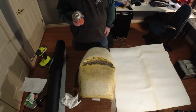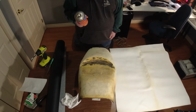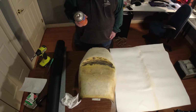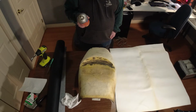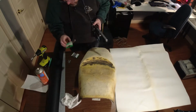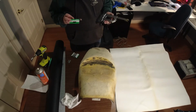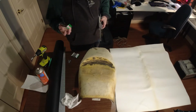Uniform overlapping coats. 2 to 3 uniform overlapping coats. Allow a minimum of 5 minutes of drying time between coats. Apply additional coats in opposite direction from the first for stronger bonds. Apply adhesive to both surfaces. Allow adhesive to dry for 5 minutes until it becomes tacky before setting. Press surfaces together with uniform pressure, limiting air pockets. Bonds should be made within 30 minutes of application. 1/4 staples, universal fit for the Arrow or Stanley TR45. Of course, this isn't either one of those.